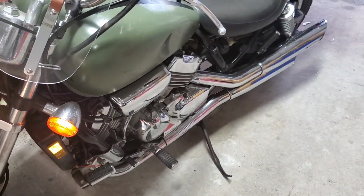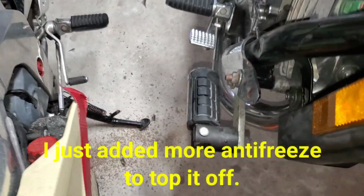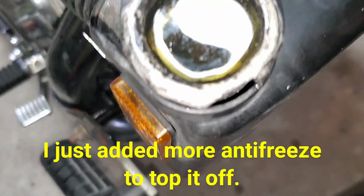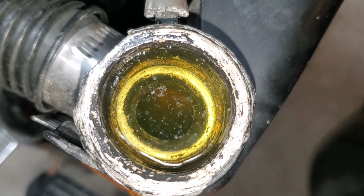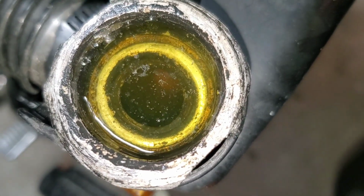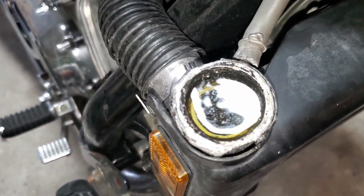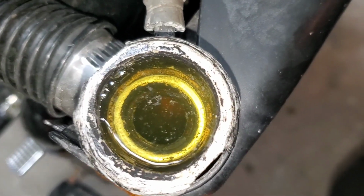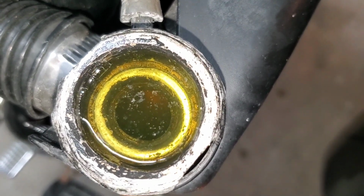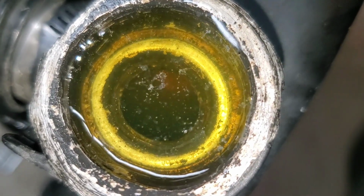What else? All right, let me get right back to you. Hang on a second. Bike's been running for just a little bit. We don't have any air bubbles or nothing, so that's good. But I'm looking for flow though. That idle is all over the place, and it's mainly because my carburetors are out of sync. So I'll probably do that on the next video. It's hard to see, but I'm trying to look for flow.